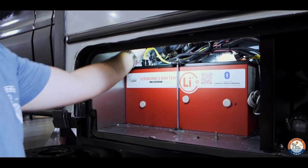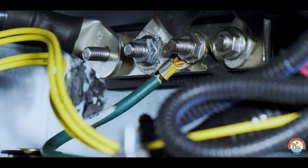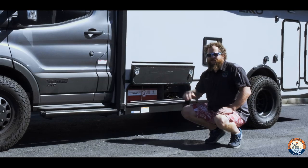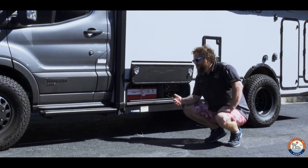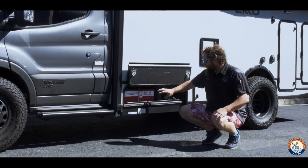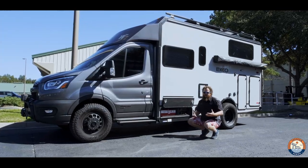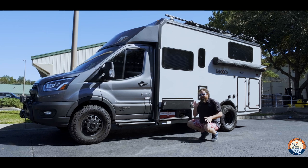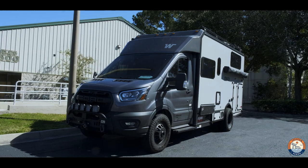That gives you 640 amp hours worth of lithium. When we do the second battery, we don't just put it in — we also do a little bit of cleaning up of the wiring near the back. We install a negative bus bar so it's easier to get all the wires in one place. And then we also install a Victron or, in some cases, a Simmarine battery monitor. This allows you to remotely log in to the Victron unit or view the display on the Simmarine to see the overall health of your system.